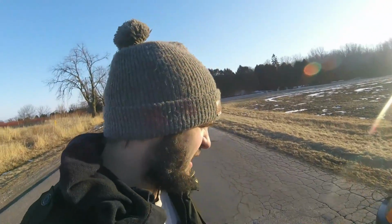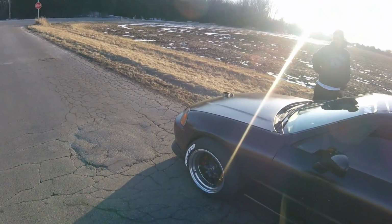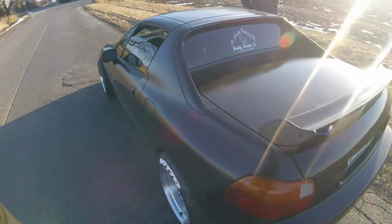Alright guys, so we started tuning on this thing. We were driving around, everything was working really good. But we noticed that something's burning. It smells like a burning smell. And sure enough, as soon as this thing comes into boost, it blows right through the clutch. So can't really tune with a smoked clutch. So he's gonna have to get a clutch for this thing, and hopefully bring it back for some more once he gets everything else dialed in.